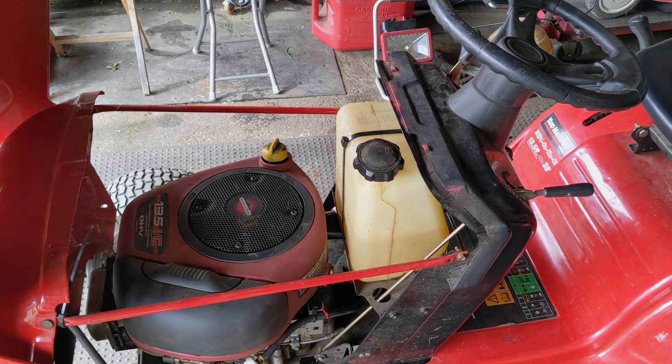Near the bottom of the bag you can see all of the fine debris that this stuff will eventually break down to. All of that fine debris, as it circulates around the engine bay, eventually loads up in that little vent there, clogging it and resulting in the engine not running properly.